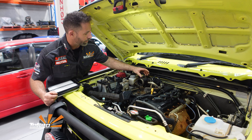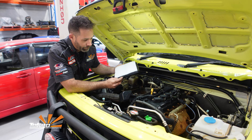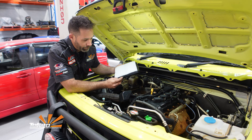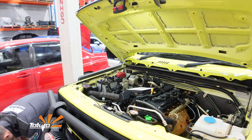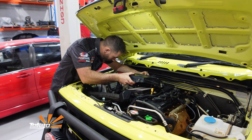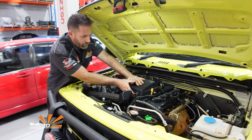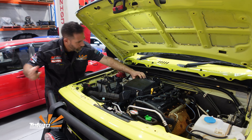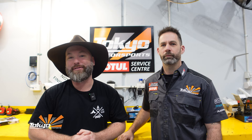The intake hose is back on. I've reconnected the air temp sensor. Just be aware there are some little notches on the rubber intake tube that line up with the air box lid and also the throttle body. Brand new air filter — look at that, fresh as a daisy. There is a little tab at the front which lines up in a notch in the air box; this particular filter goes foam side down. Air box lid slides onto the air intake pipe — line up that notch. Two tabs at the back locate it. Seat it down nice and firm, do up the two clips and hose clamp. Remember, don't over-tighten your hose clamps — just down, secure, and snug. And that is the air filter all sorted.